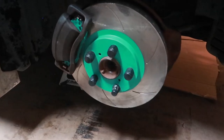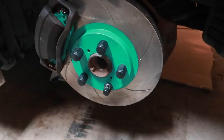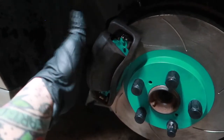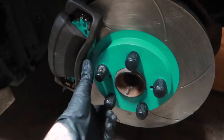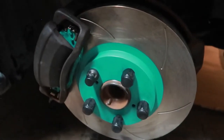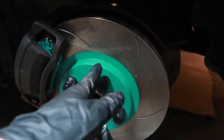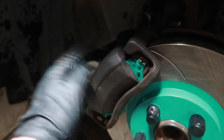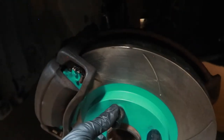I had to bring out my brother Warren to help me. I just couldn't figure it out. Disassembled everything, reassembled everything. For some reason, once the caliper portion was on, piston receded, it was stuck. I couldn't figure it out. I thought maybe the rotor was warped. I checked all the rotors. Rotor was not warped. I checked to see if there's any obstruction between the rotor and the caliper itself. No obstructions. Maybe the pad or the hardware was binding on something.